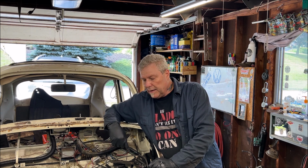Okay, I'm going to let that tack up now a little bit. Drying time is 2 to 4 hours. I still have a little under 2 hours to put a second coat on that, which I'm going to do. If you wait longer than 2 hours, then you've got to scuff it down. I think it's with 150 grit wet, I can't remember, you'll have to look it up, and hit it with a second coat. But I'm going to do that before it dries.